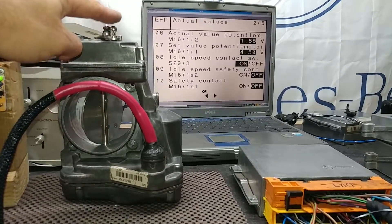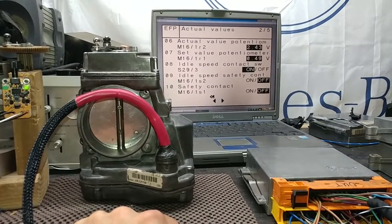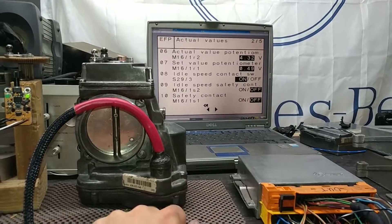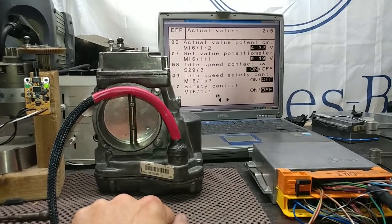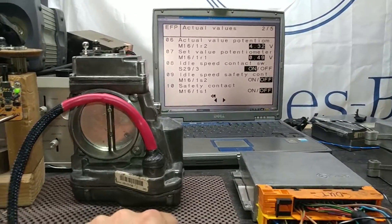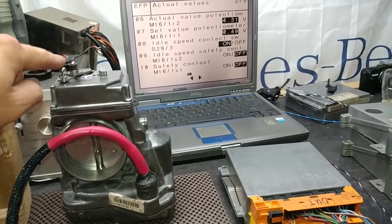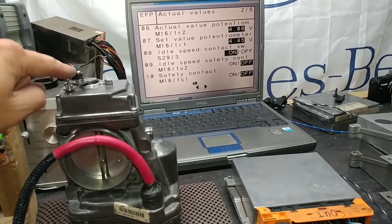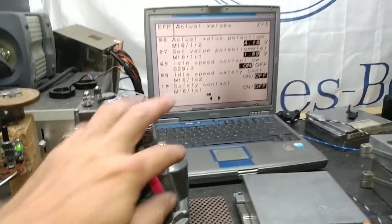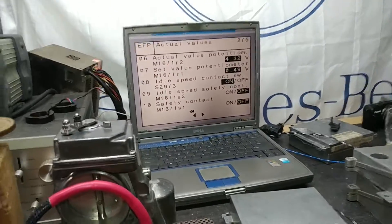What's interesting about this particular S-class module is that it does not register the micro switches — but that's an S-class difference. I'll show another module that will allow me to open the throttle all the way so you can actually see the micro switches are registered, just to prove they do work. Let me pause this video, reset everything, and connect to a different module to prove that the internals and throttle are good.